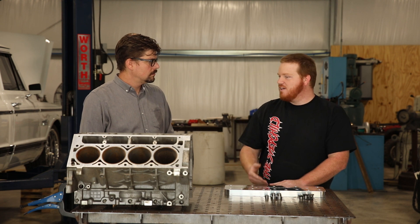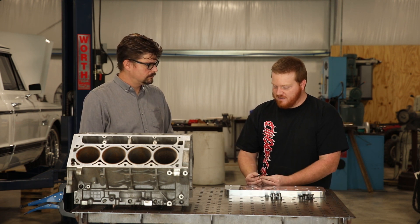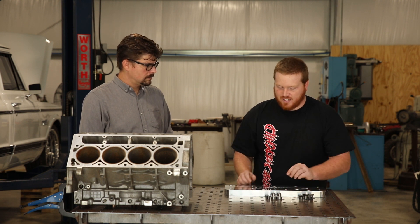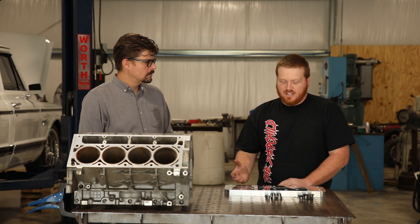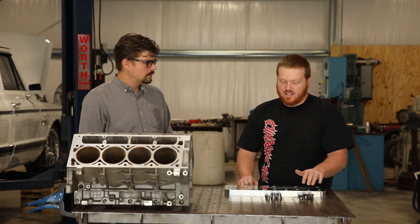You need a hand drill and common tools, plus air to blow chips out of your holes. We provide locators to locate the plate onto the cylinder head surface, adapters to fasten it down and actually secure it using stock head bolts, and we supply the drills and bushings and tap guides required to drill and tap the hole.